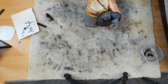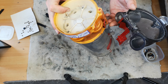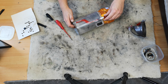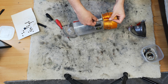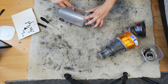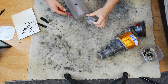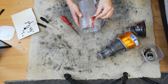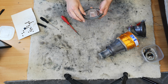So where do we start? If you want to strip down your machine or you're following along at home with yours in bits, you pop the top bit off of the cyclone using a little screwdriver, then take the bottom flap off, push the button and take the bin off of the cyclone itself. On a DC24 it is relatively easy. We're not going to be moving the red part, but you can if you wish.